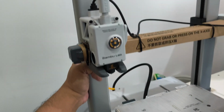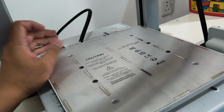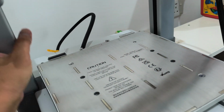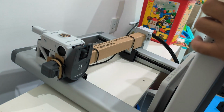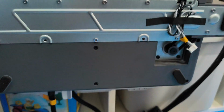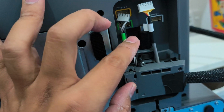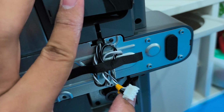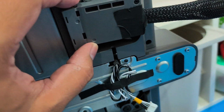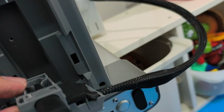Turn the machine upside down, facing this way, and you can put in the cable. Slowly, it's quite heavy. One hand is the base on the table like this. Then you're gonna slot in that cable. Basically, what you need to do is to look at the wires, the green, the white, and the other one in yellow. They already labeled it. Also, there's a screw here. Once you attach it, snap it, and you need to screw it in.